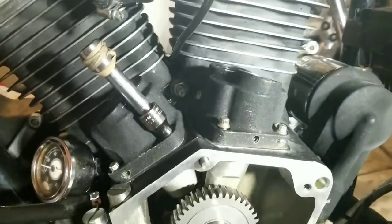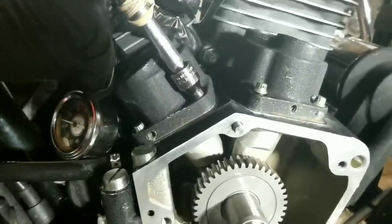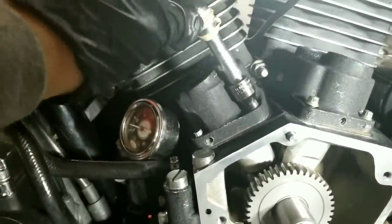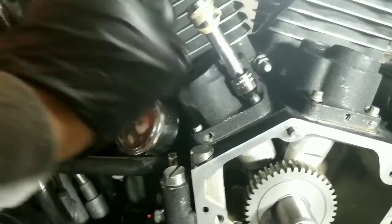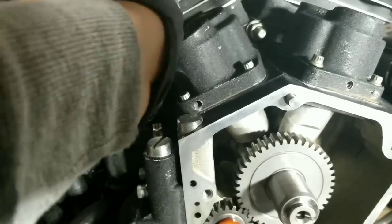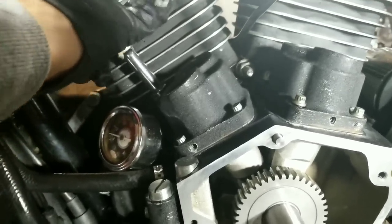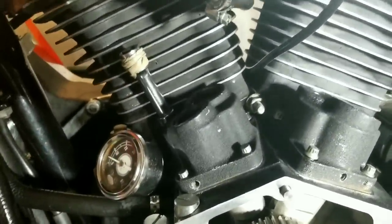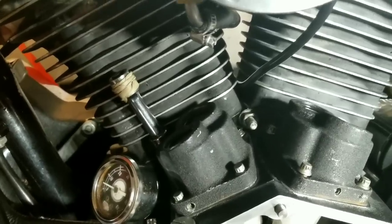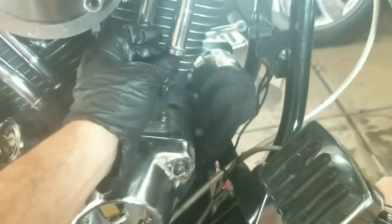Now put on the tappet block. There is limited space behind the rear tappet block, so I got some rubber bands and wrapped them around the extension and used it manually on my hands to get it started, just to get space going — the same way I took them off. Hopefully that'll help somebody out there if you have any issues. Going to tighten these down a little more and then close up the cam case.